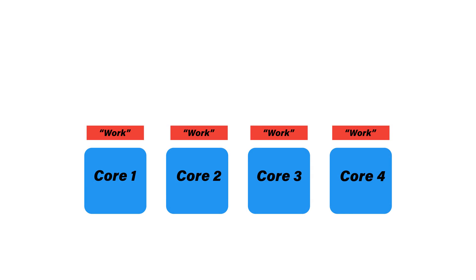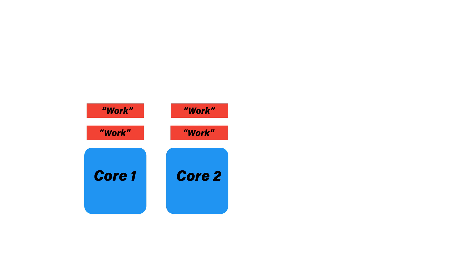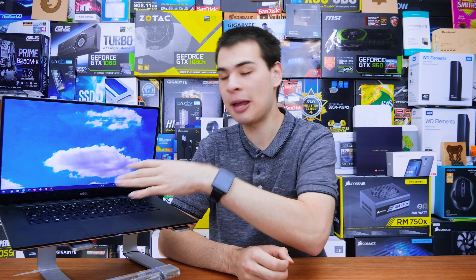There are a lot of different states a CPU can go into depending on the task it's doing. If it's idling, cores go into a sleep kind of mode rather than being completely maxed out. The workload is spread across all cores and threads for a fairly lightweight task. Now, this unit is a 4-core, 8-thread machine. If we run only 2 cores and 4 threads, in theory we should get half the power used, right? Well, there's actually more logic behind it. Running the OS with a few background tasks spread across 4 cores and 8 threads — if we disable half of them, that same workload still needs to be carried out by the 2 remaining cores and 4 threads.